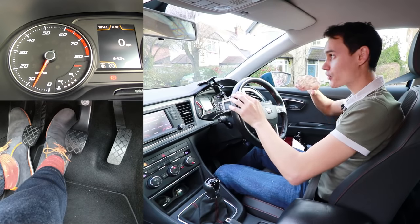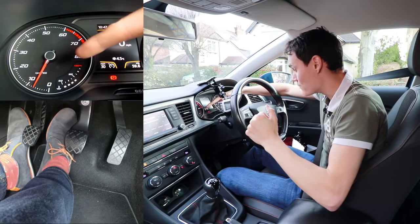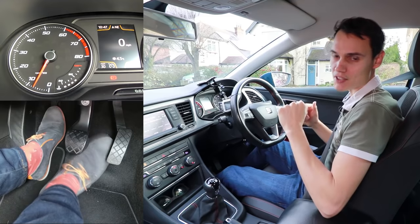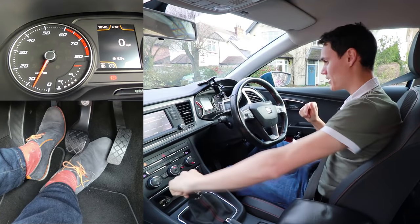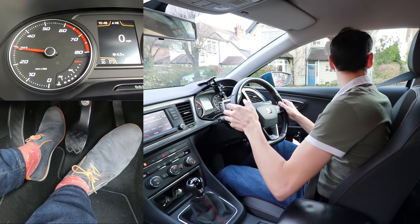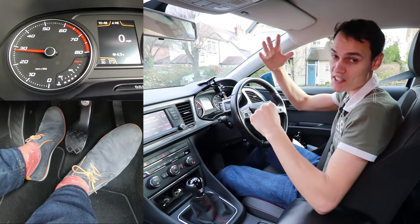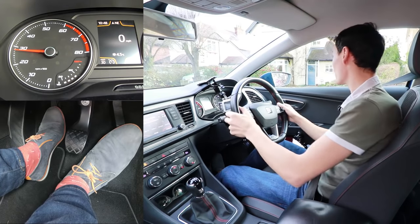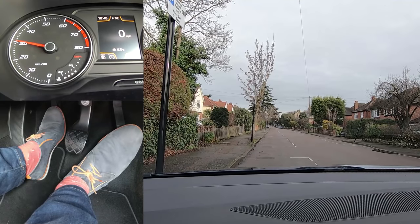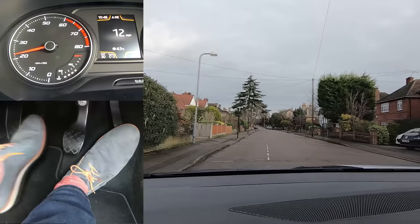The best way to know is to feel the vibrations and tune into them - you'll notice they change when there's no more slippage. I'm going to move away now giving 3000 rpm of revs so you can hear it properly over camera. I don't recommend 3000 rpm normally as that's too many, but it'll make it louder for you. Clutch down, first gear, handbrake off, about three grand of revs. You'll notice the revs drop a little when I get to the bite point - that's normal - then they'll stay the same, and when the clutch has finished its job they'll start rising again.